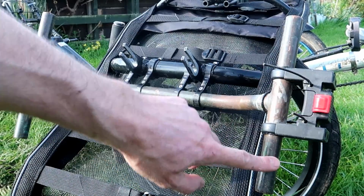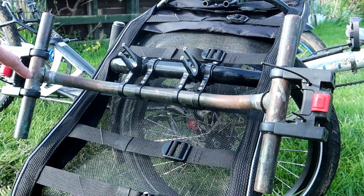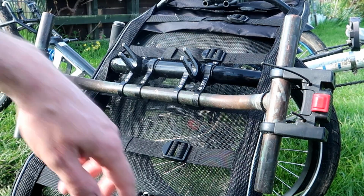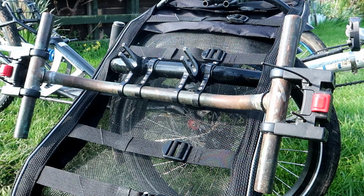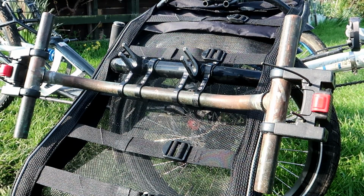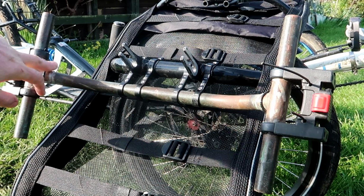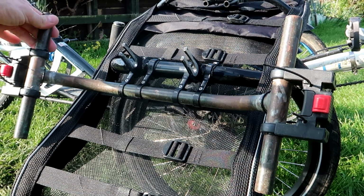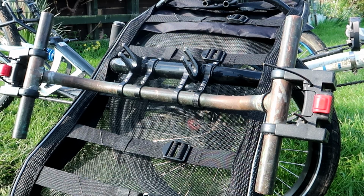two pieces of straight pipe either side, and in here on each side is a T-junction. So this piece of pipe goes straight through the T there, and same there, and obviously fits in there. It's all from gas fittings. Normally this would be gas pipe in your house, or water pipe I suppose. So once those were all shaped and cut to length, I heated them up and brazed the joins. It's not particularly clean. I suppose I could have painted it. It's hidden underneath my chair all the time, so yeah, I'm not too bothered about that.